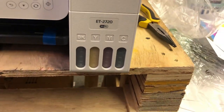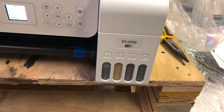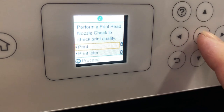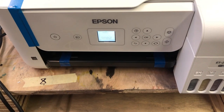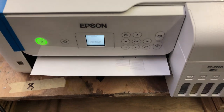This is the ink level at the start of initialization. This is how the ink gets sucked into the printer — notice the black, about a quarter of the ink is gone inside the printer. When the initialization is complete, always do an adjustment, which will print out a nozzle check. In nine out of ten cases, you're going to get a perfect nozzle check just like this. Now you can start using the printer.